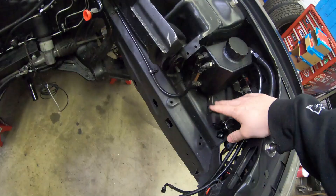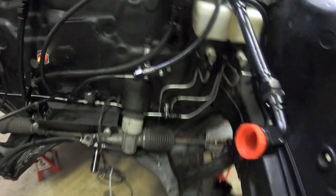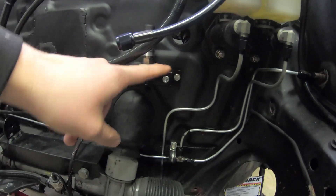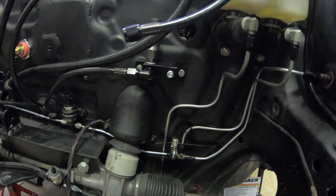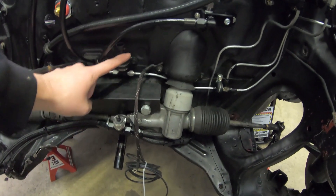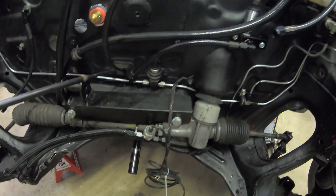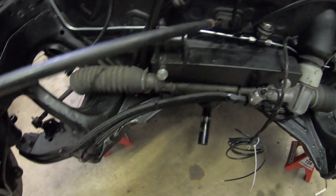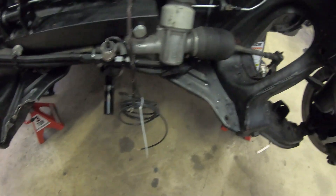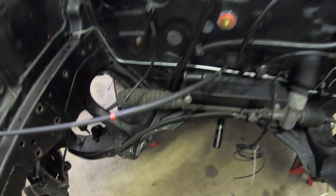Been over the oil pressure sensor - I hate where it's at, but we're gonna deal with it. MAP sensor's mounted on a sensor block. I got a spare one because I thought the oil pressure was gonna go there, but not gonna do that anymore. Rolling on to brake pressure - just had to cut and re-flare this line to this T, so that's mounted and done, ready to go. Got this part of the subframe trimmed out. You can see compared to that side, so hopefully we'll have more room for the transmission there.